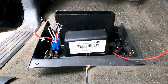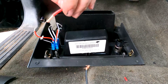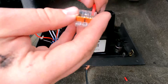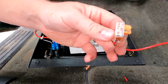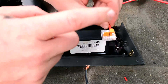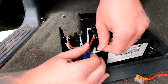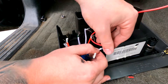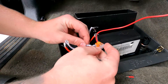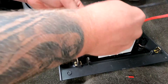I'm going to leave myself quite a bit of wire so I can pull this out when I need to without taking the center console all apart. This here is one of my first motor leads. I'm using Wagos — if you don't know what these are, I'll leave a link in the description. They are absolutely amazing. Now I'm going to start with the bottom part of this switch. You're basically simply crossing your switch so that you have the ability to reverse your motor — it's a very simple process, don't be intimidated.